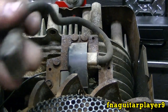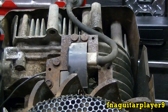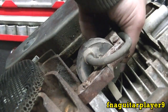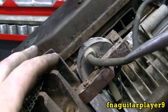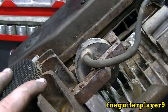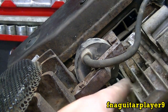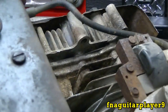Getting back to the purpose of the video: you want to unhook your spark plug wire. See this wire right here — it's the kill wire, your shutoff wire. Just unhook it from the coil; probably get needle nose pliers on it and pull it off like that. It just clips on there. This little tab right here is your connector.